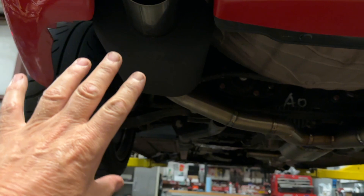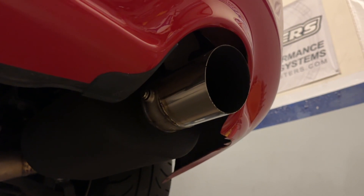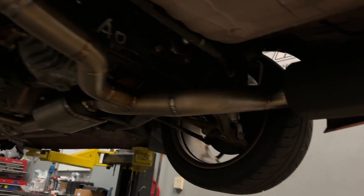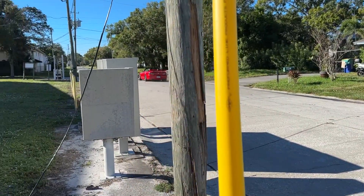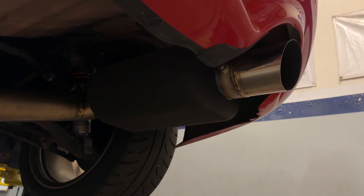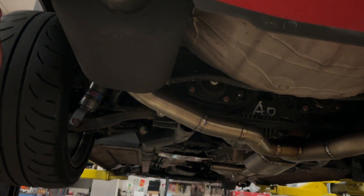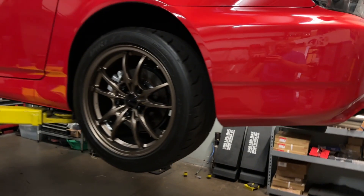It branches into a two-and-a-half inch, so it comes out this side — the whole thing is titanium. This is a boost-activated valve: at four-and-a-half pounds of boost that valve opens and it's a dedicated straight-through three-inch — still pretty mellow, actually quieter than I was anticipating. When the valve is closed all the air is forced out of this one — this muffler acts kind of like a Helmholtz resonator — and then the gas comes back out of this one. Very seamless — you don't feel the valve open, you just hear the sound change. Very quick to open, quick to close — no switches.